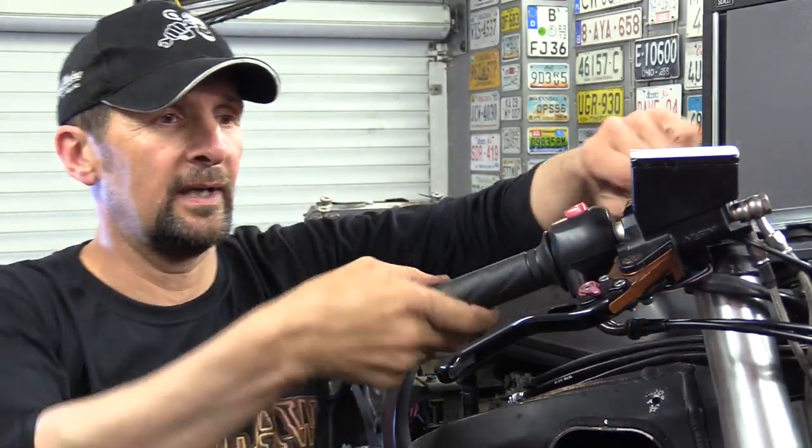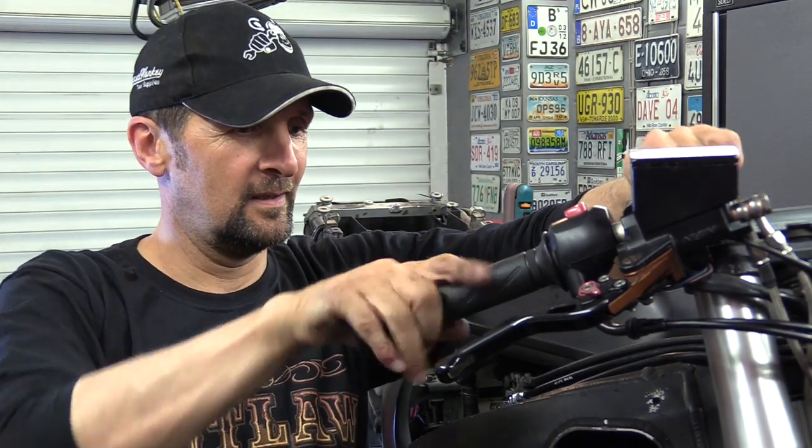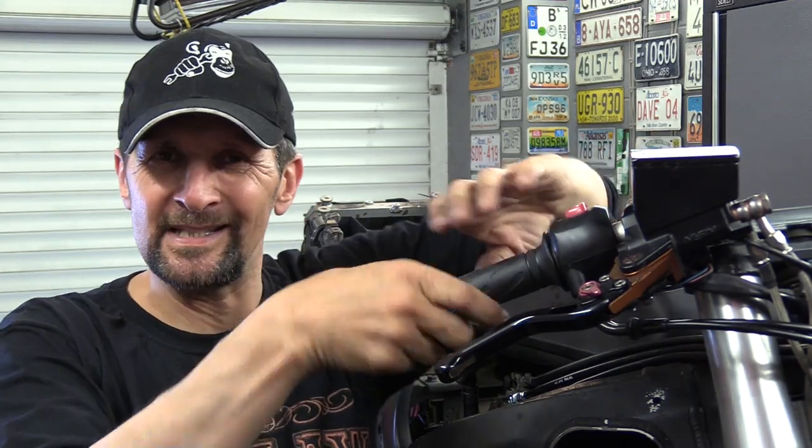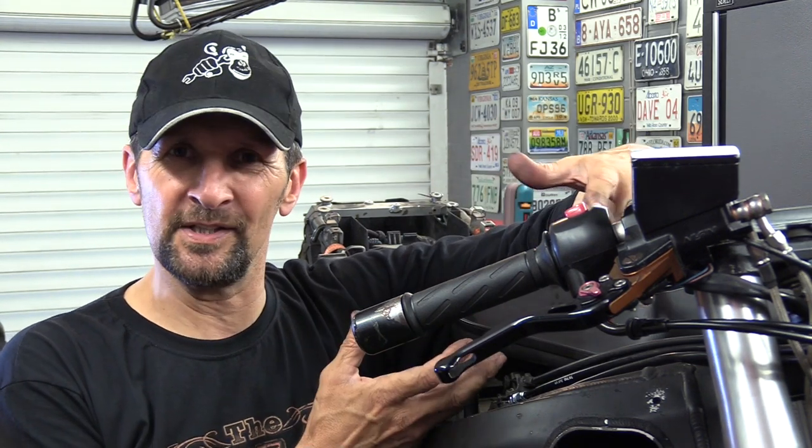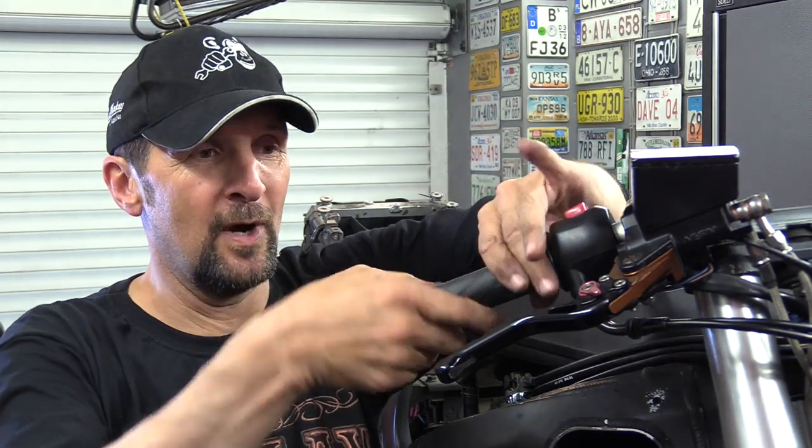Right, all routed correctly. Proper snapback. Look at that. That's absolutely lovely. When you buy an old bike, you find sometimes they always ride like that, a little bit chewy. The levers are a bit chewy and the throttle's always a little bit stiff, and that's just the way they are. No, it isn't. It's old cables that get full up with snot and slime and they're just nasty and horrible inside. Stick a set of new Slinky Glide cables on, a new tube as well, and that's like a brand new bike. Absolutely lovely.